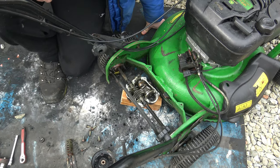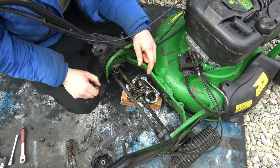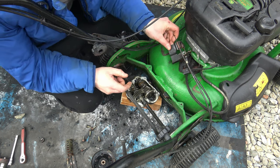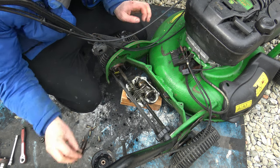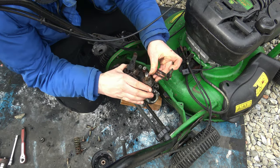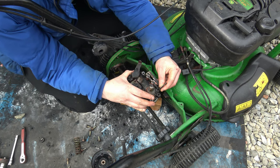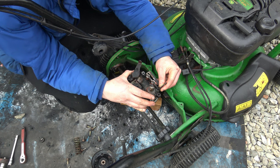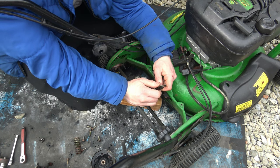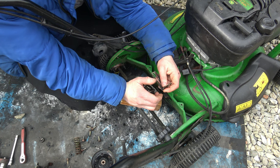I went to get a pair of gloves and couldn't find any, so I'll just stick this out. Before I go any further, I should point out that some people state adjusting the clutch cable on the gearbox is going to work - yes, but only if the clutch is not worn beyond its limit. What this fix is doing here - hopefully - is basically bringing the clutch back into spec. What I'm going to do now is drop this gearbox out, remove the bit of timber, and carefully lower it down.